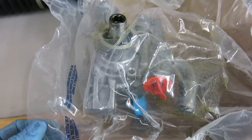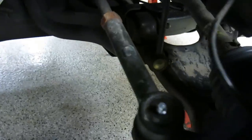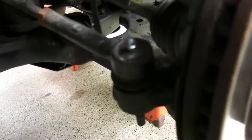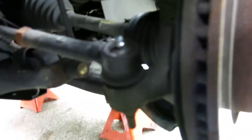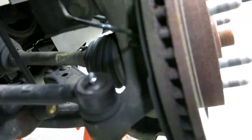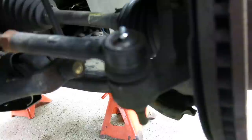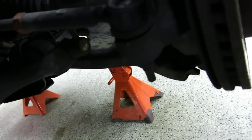I also have a brand new power steering pump that we're going to replace. So here we are — the wheels are off. The first step in the manual is to disconnect the outer tie rod ball joints from the steering knuckles. You might notice that this outer tie rod end looks a little different than normal — I installed a Zerk fitting on there to try to quiet a noise we've been having on this car. It didn't help, but that's why it looks different.